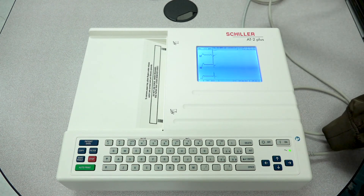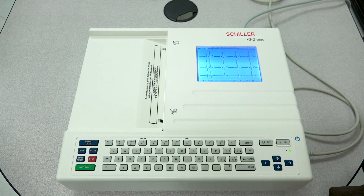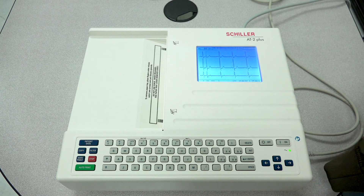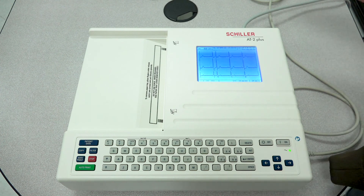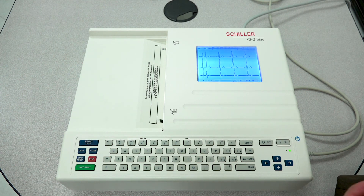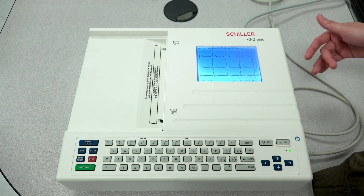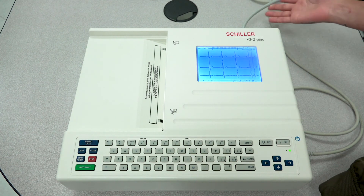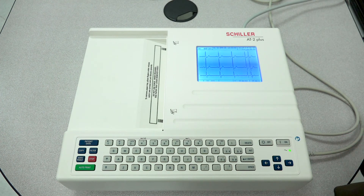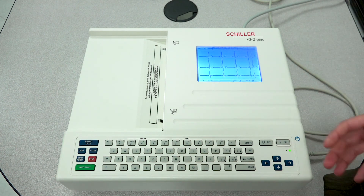When you encounter that, connect your unit to the power outlet and please allow your unit to charge for at least two hours so we can know your battery has had some type of charge, then simply turn on your unit and try another print. If you've charged your unit and are still encountering power issues, your unit may actually need servicing. The common culprit is the internal battery not holding a charge — no matter how long you keep it connected, it won't make a difference because that battery is defective. In rare cases, the charging circuit on the main board is not charging that battery, which will then lead to the board requiring replacement.